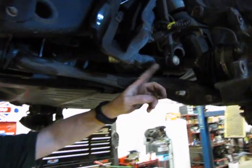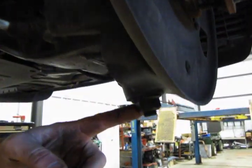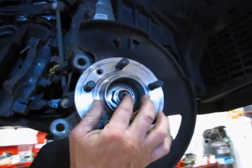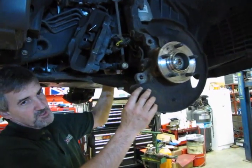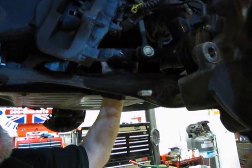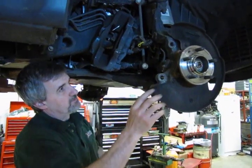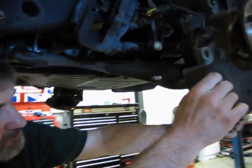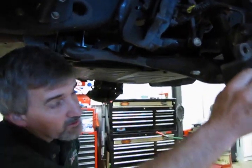You've also got your shock absorber air suspension bolt right here. That's going to come out. And then your lower ball joint right here. And this arm will be able to slip out of here once you remove those. Now you're also going to remove the nut off the axle because you're going to retract that axle some as you come out forward. You don't want to disconnect this inner CV joint internally. So we're going to push that axle in and get it to slide on the knuckle in the hub so that we can pull this out far enough without yanking that outer CV apart. So 15/16 is going to be your inner bolts, your ball joint bolt, and the nut for your shock, with a 7/8 wrench on the other side. So let's start taking it apart.